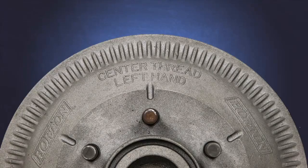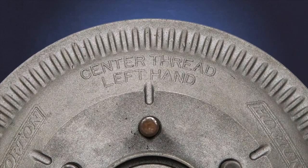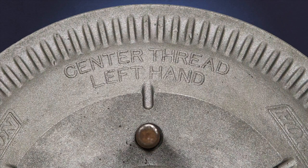Notice that the plate will say left hand thread. This often intuitively signals the installer to reverse the setting on the tool to clockwise to loosen. However, to loosen the center jack bolt, turn the T55 Torx bit counterclockwise — or lefty loosey — while holding the friction plate from rotating.